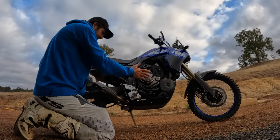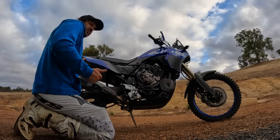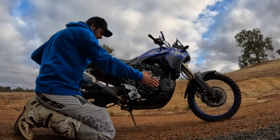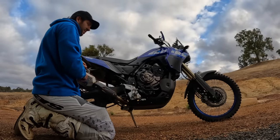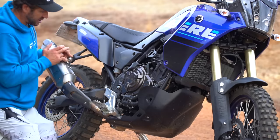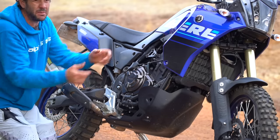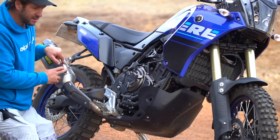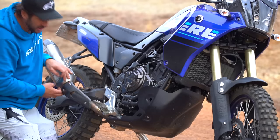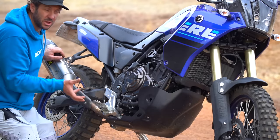Just run it — get the whole system warm. That's loose, that's loose, but as you've run it, got it hot, it's relaxed in its position — it's rattled, it's revved, it's exactly where it wants to be. Then you lock off the clamp, bind that as one, and once that is bound and relaxed in its position, finish off by doing up the muffler bolt. So your priority is: headers, clamp, muffler bolt. If this has just been thrown together quickly and you forgot to do up the headers, something's going to crack — either the header at the top, a mount, or around the hottest point. Longevity of your components can be determined by the order in which they've been bolted up.